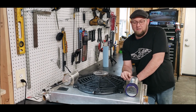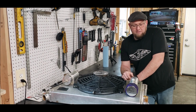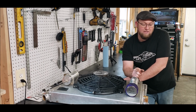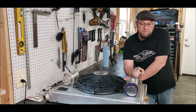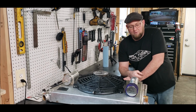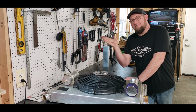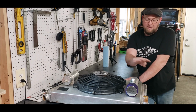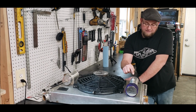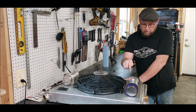As good and clean as they looked when I first did them, there are a couple of major drawbacks in my mind. One, this Aerospace Components catch can is 100% garbage. There's no baffling whatsoever in it. So when the vacuum pump is pumping crankcase pressure into this thing, it sweats ridiculous amounts of oil out of the filter. And the radiator cooling pack has a forward lean to it in the car, so all of that oil was misting all over the shroud. Also, when I went to drain this, due to the lean forward, I would end up with a ton of oil draining onto the shroud.